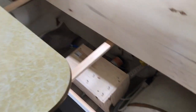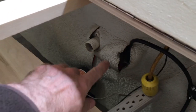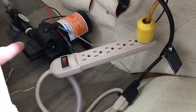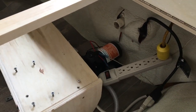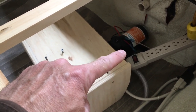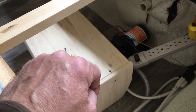So here's the other side of the trailer. The water tank used to be in here but I took it out and put it in the other side as I showed you. This is the plug right here coming in from the outside — just bought it off Amazon. I just plugged it into a surge protector, which sits on top of this box that protects the water pump. I've also got a little trickle charger that maintains my battery. If I'm plugged into shore power, it'll run my lights without putting a drain on my battery at all. The pump is actually too big, so I've got a smaller pump I'm going to be putting in there, and I might use the bigger pump as the drain for my shower.